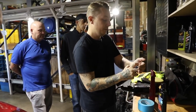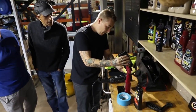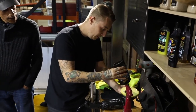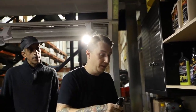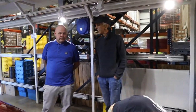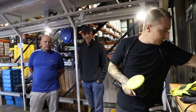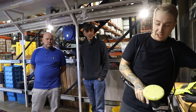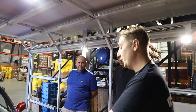Every time I want to do a new section, all I'm going to do is put five little dots on there. You can do a happy face, a sad face, a cross — you can do whatever you want. I just like doing dots. Golden rules on machine polishing: always keep the cable over your shoulder so it's not going to rub on the paintwork. Always start and stop the machine on the panel — that way you're not flinging product everywhere.